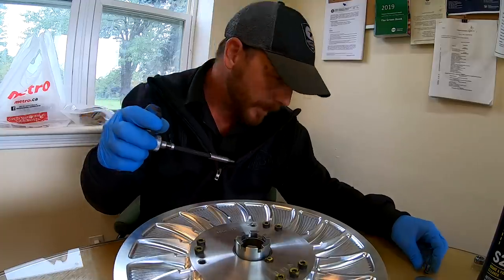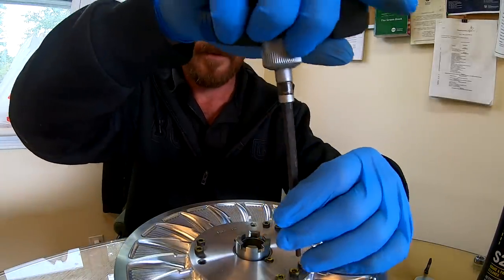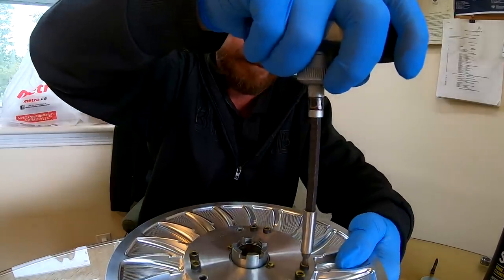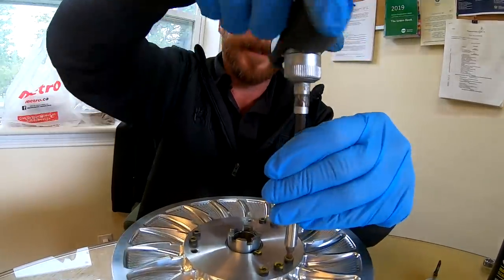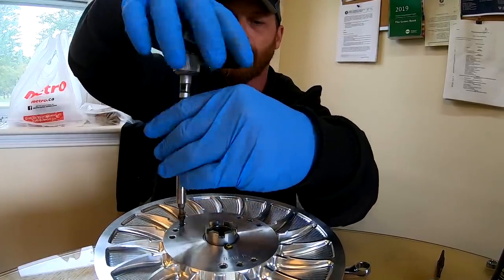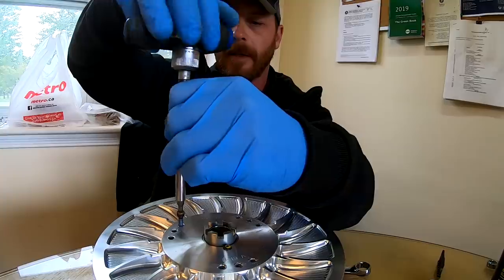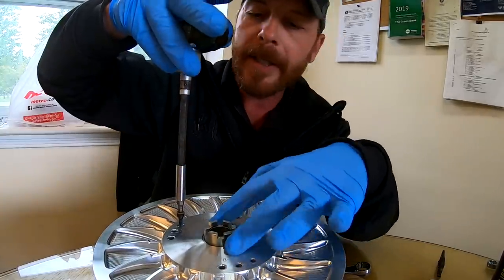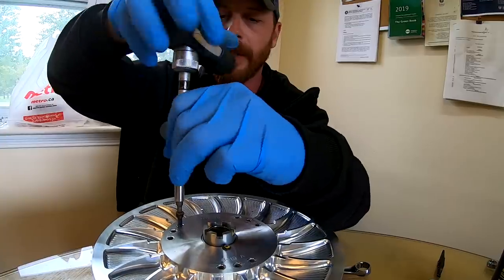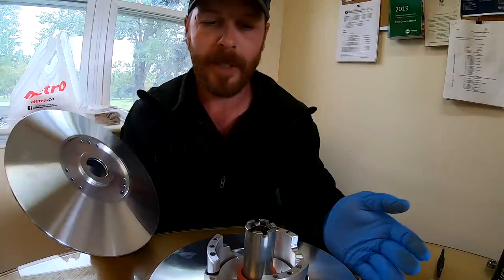You've got to make sure when you're doing this — they recommend you clean all these threads, clean out these holes, get all that old Loctite out of there. You definitely don't want that crap in there. We'll go to the furthest to the right again, nice and easy. There's really not a lot of torque on those — surprises me. Last one and our helix should be free, which should let us separate these sheaves. I see another pair here — not sure what they're holding, a one-way bearing or a spacer — but I don't think they have to come out. There we are, we are at our shims.